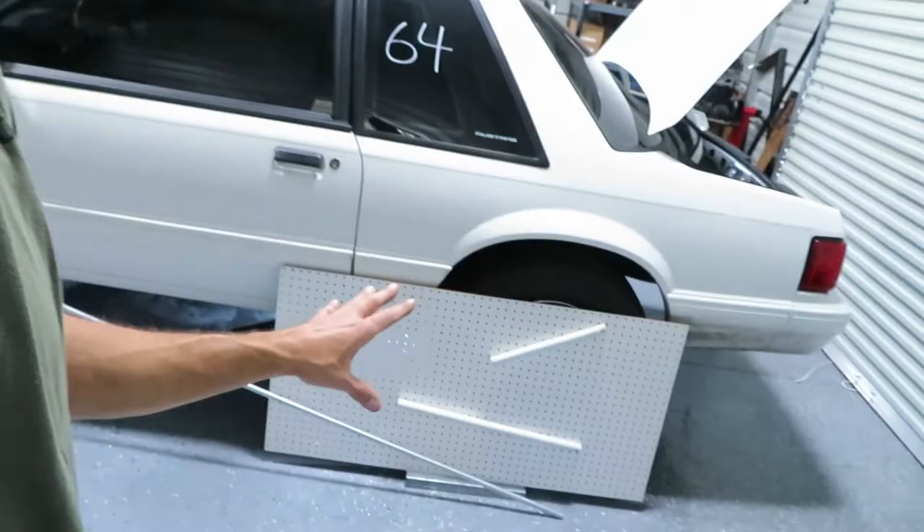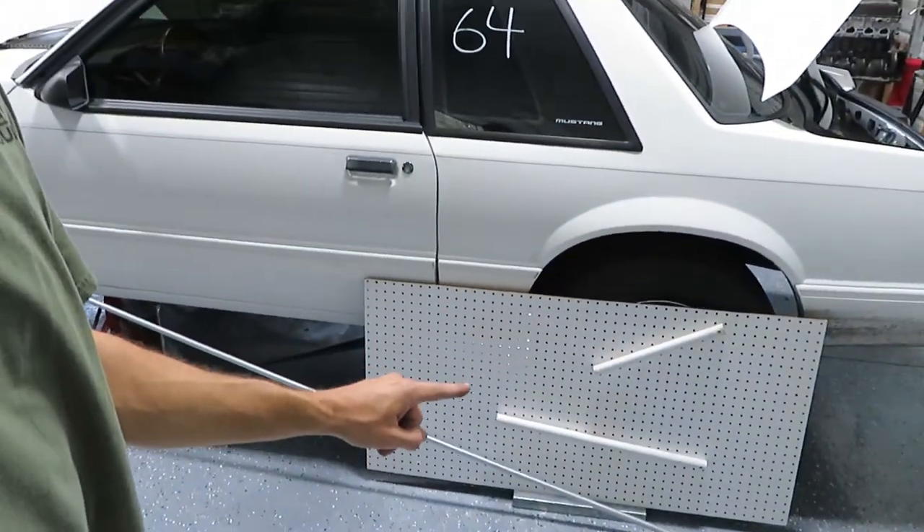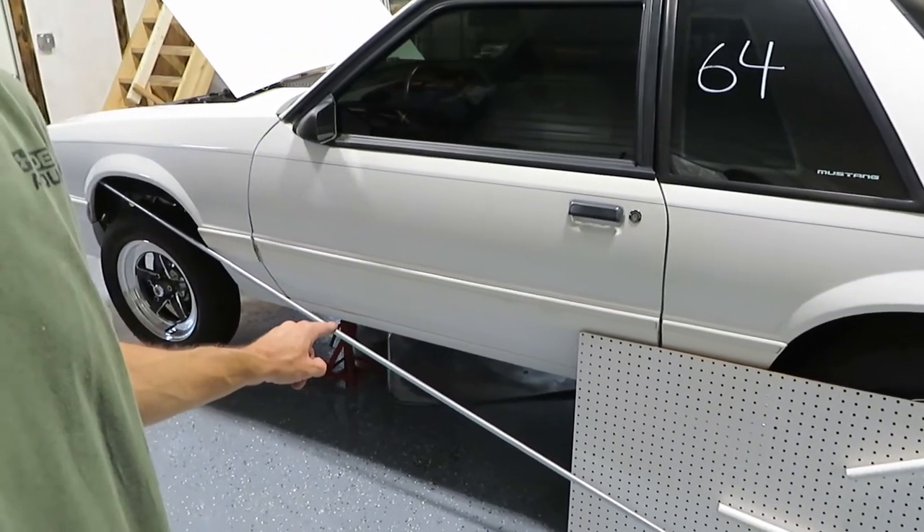The further back you get with your instant center, the harder the tire bites — harder and harder. On a low horsepower car, that's what you want — maximum bite. On a higher horsepower car, that's not always desirable. If you set it up with maximum bite on say a thousand horsepower car, it's going to bite really hard initially but then shake the tires after 20 or 30 feet. That's why you'd move the instant center further out, closer to your center of gravity, to soften the initial hit and let it settle into the run.